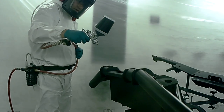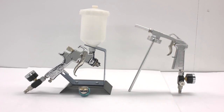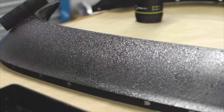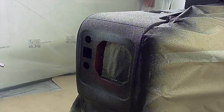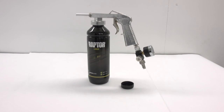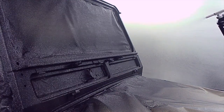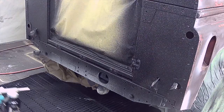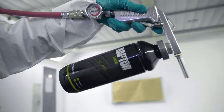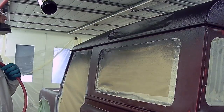Designed and manufactured for easy application, Raptor can be applied using many different methods such as conventional spray guns, Schutz guns, roller or brush, creating a variety of textures. We specifically wanted an overall coarse texture for the Land Rover body and used a Schutz gun, which attached directly onto the activated Raptor bottle. Spraying at a distance of between 50 to 75cm in a sweeping motion with an air pressure between 4.5 to 5.5 bar set at the gun, our team hit the spray booth applying two coats.